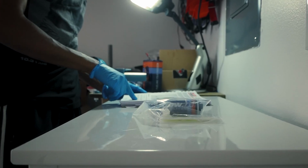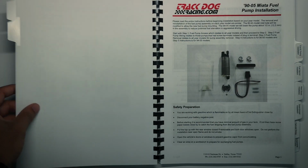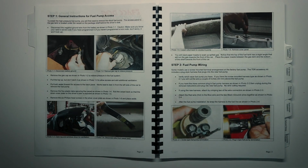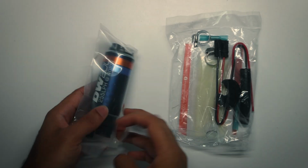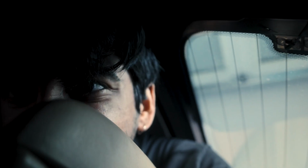Rear window if removable. Closed. So the fuel pump is located on that back parcel shelf of the Miata, and I noticed that wind blocker was really making things more difficult for me. So I got started unscrewing that to get out of the way.